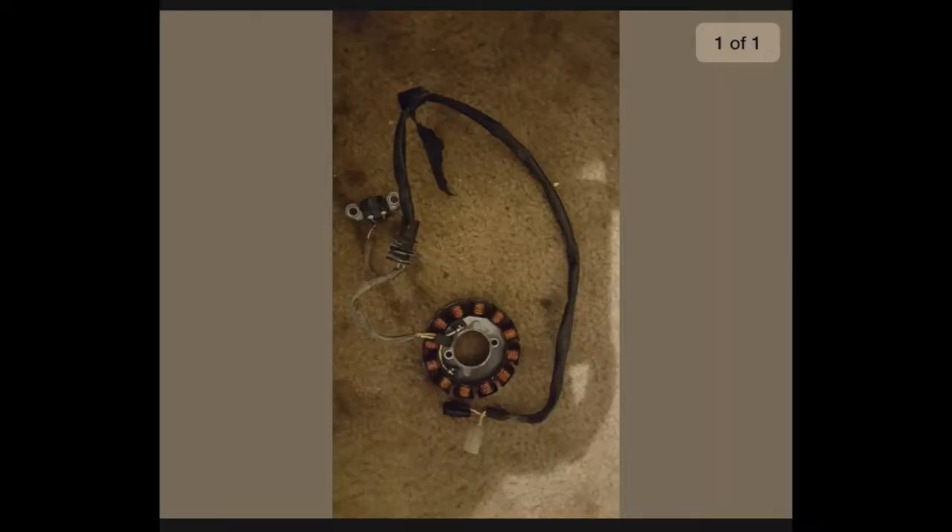I went on eBay and purchased an OEM stator. I figured I got it narrowed down after I replaced a couple parts. The stator was aftermarket and left some holes in it. I tried to do the resistance test and it didn't really seem like it was going to be working too accurately for me. I've had spark issues in my 660 Raptor because of the stator, so I decided to look for an OEM replacement and we're going to get that installed.